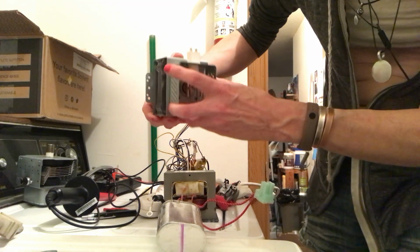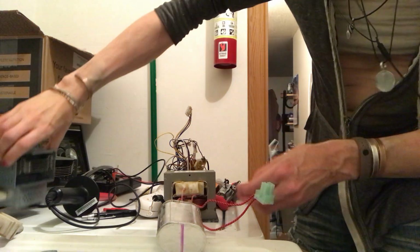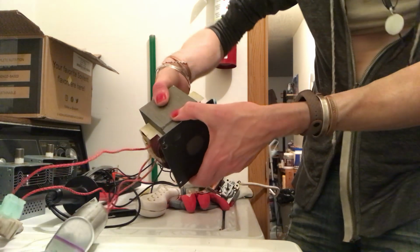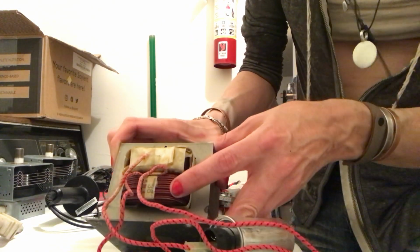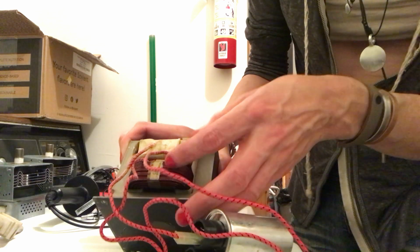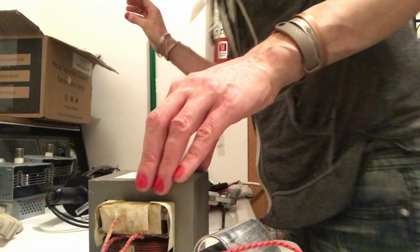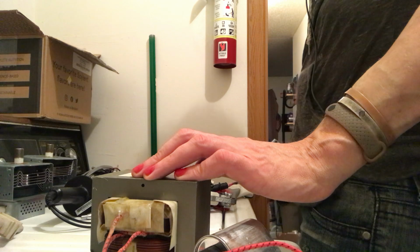Yeah, okay, so the magnetron is a tube, of course, and it has to have the heater, which is accomplished by, if you look at the windings here, there's a primary, there's a high voltage secondary, and then this is the heater one in there. And a lot of people will cut these out, and you can get the really thick gauge. Let me see, I'll go get it.